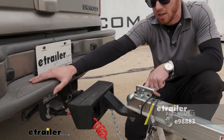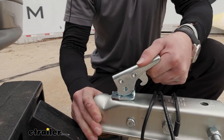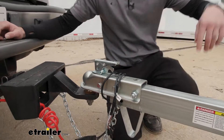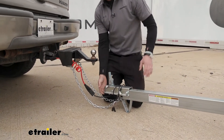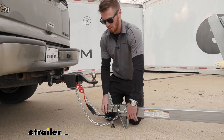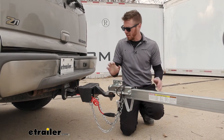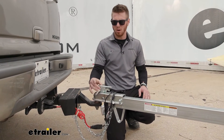One thing you should get is a little pin that goes through here just to lock this latch into place. The diameter of that hole is about five-sixteenths of an inch. We also have a little bumper here — so if you just wanted to lay your trailer down, it's not going to get mud or whatever inside of your coupler, so it's going to stay nice and smooth. That's how it'll be outside your house or in your garage if you don't have any jack stands. So you just need a ball mount, wiring, the right ball, and then a pin.